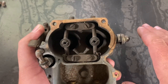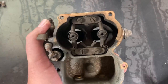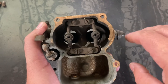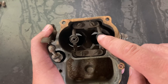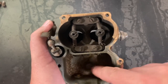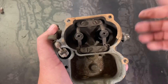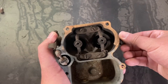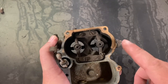Now that we're idling, we can go ahead and depress the accelerator pedal, which will slowly open the butterflies on the bottom of the carburetor. As you open those butterflies you introduce more air into the opening. As the air passes through the venturis on the sprayer nozzles, you will pull more fuel out of the bowl — the more air you introduce, the more fuel you will pull out. So now we have an idle circuit and a metering circuit.